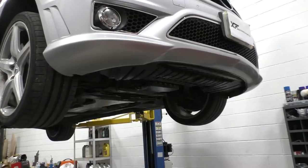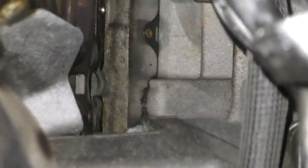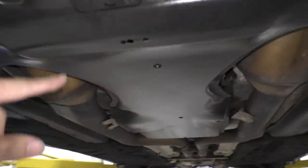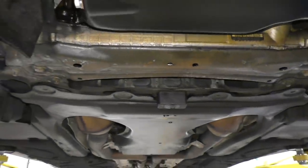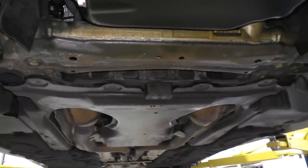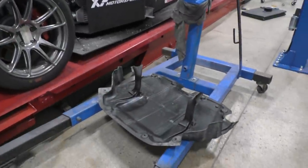After driving the CL, here's a look underneath — so far it's looking pretty good. I don't see any of that old oil that was seemingly leaking from the head gasket area, and I cleaned up all that area after the repair, so no new oil is dripping down so far. There are no drips underneath either, with the only exception being the rear main seal, which is still leaking. But even that isn't a bad leak — looking at the floor there's nothing, just two little drips. That's still something that's leaking, but hopefully a minor one. If it bothers the owner enough it would be a whole separate repair — the transmission has to come out to get to the rear main seal.